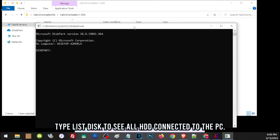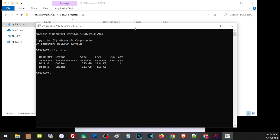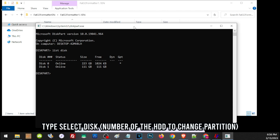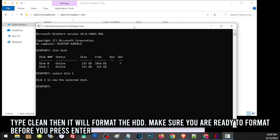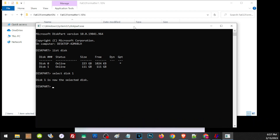Press Enter. Then type list disk and press Enter. Here you will see all the hard drives connected to your PC. The one we need to change the partition on is Disk 1. Type select disk 1. Once selected, we have to format the hard drive first by typing clean. But before you do that, make sure you have no important files on the drive, because cleaning will reformat the hard drive and remove all content. Back up all your files first. When ready, type clean and press Enter. You have now successfully formatted the hard drive.